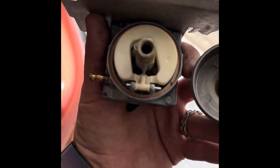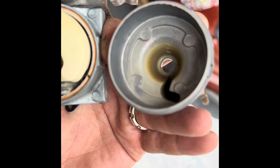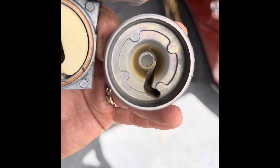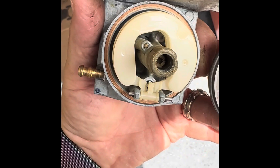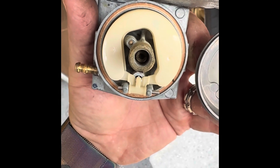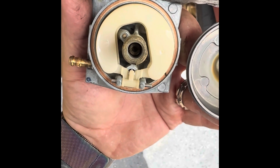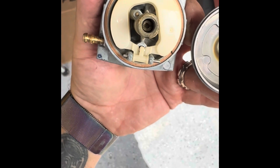It's upside down right now — it goes like this. Releasing the float bowl from the bottom of the carburetor should open us up to the internals where we can inspect and confirm our suspicions of a gummed-up carburetor. Upon initial inspection, everything looks fairly clean, but you can see all the yellow down there — that's probably some buildup. Down in there is the main jet. We need to pull that out as it probably has gummed-up residue from ethanol gasoline.